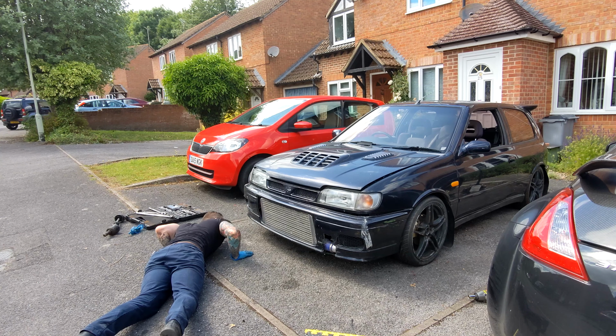Except for the clutch. But normally, my point is, if the gearbox is gone, you can hear it anyway. Oh, like yeah. In any sort of gear. They would have heard that. That would have been more clutch for them. Yeah, so the clutch stinks. Clutch is either rusted out and we're scraping layers off, or it's gone. But we knew that, and that's not a big deal. The point was, is the gearbox blown? And the diffs. Because these cars are prone to chocolate gearboxes. They just blow up. You've got a good one.